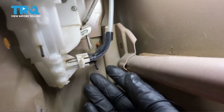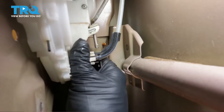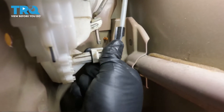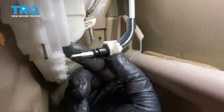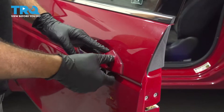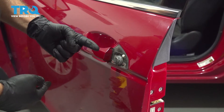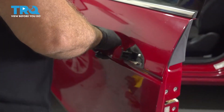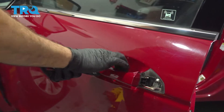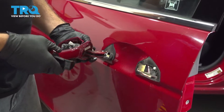On the inside of our door panel we have our lock mechanism, which comes down from the key lock cylinder. We're going to pull this plastic clip right here towards the front of the door — that'll snap forward — and then remove this whole unit. It snaps out. Now we want to slide our lock cylinder cover outward and slide that off. Then we're going to take our door handle, pull it this way, lift it out and away — by doing that you're disconnecting the back linkage and the actual linkage on the front of the handle. Work this up and pull it out at an angle.